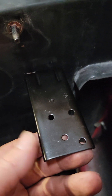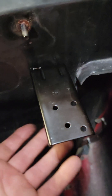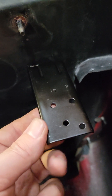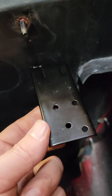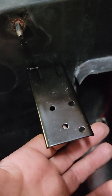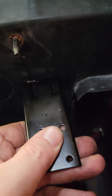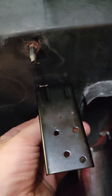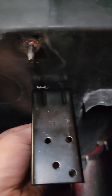Just pre-mount this to the light and then take it back off. If you're going to do it by yourself, do that — that way the holes are not so tight. Normally we want a tight hole, but in this case we want it kind of loosey-goosey so it just goes in a little bit easier. Then once you get the light adjusted and lined up to the car, you can tighten it up.